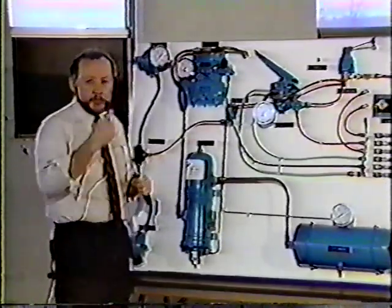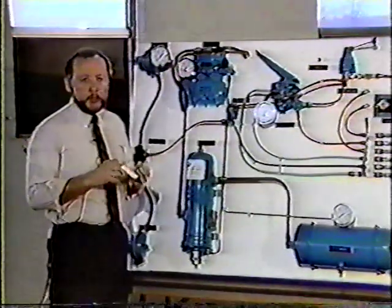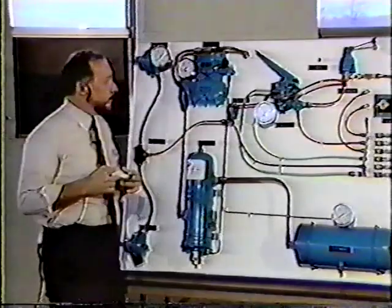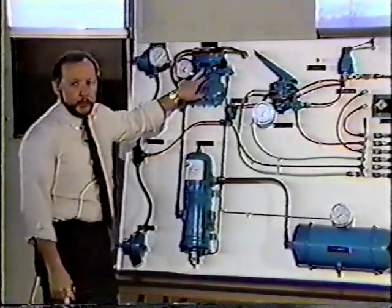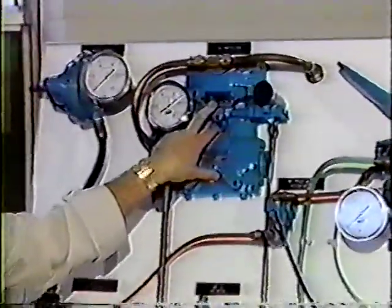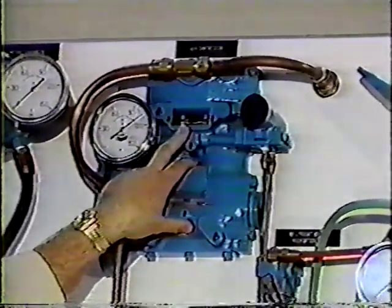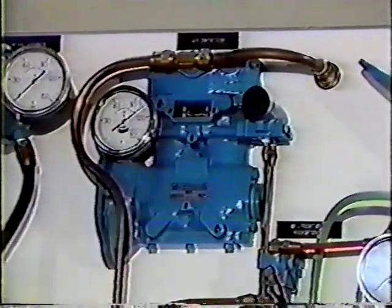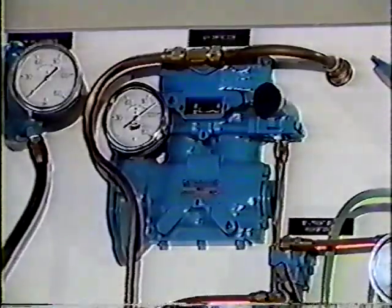The compressor, kind of consider it as a small engine. It needs clean air, it needs to be cooled, and it also needs lubrication. On the clean air side of it, we have our intake right here, and very important, the compressor has to receive clean air. If it gets dirty air, it will end up as an oil-passing compressor in a very short amount of time. It will ruin the cylinder walls, and the oil will come up past the rings and into the system.